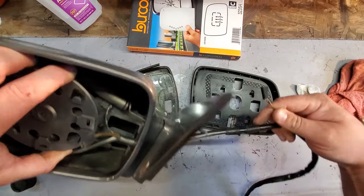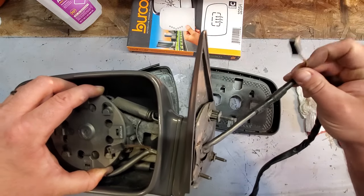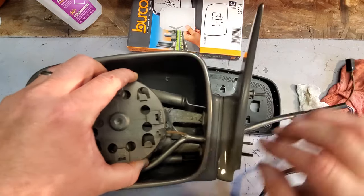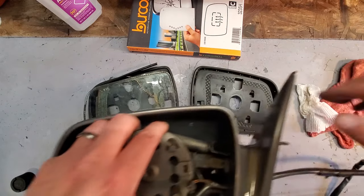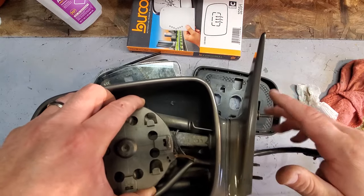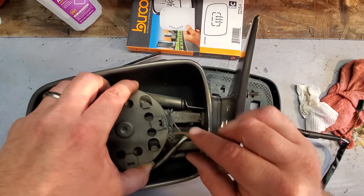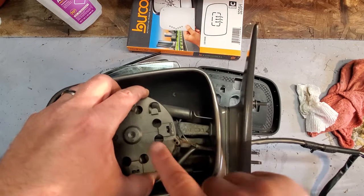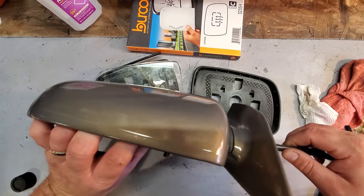Here we go. So when the rearview mirror detects that it needs to be auto-dimmed, it sends the signal through this wire into here, into this piece of glass, and that is what dims the mirror. It's completely dependent on the mirror. Again, it's a slave system. Whatever the rearview mirror decides it will be, this mirror will be. And that's, again, to reduce the glare into the driver's eyes.